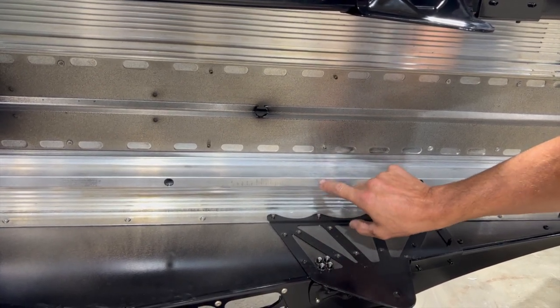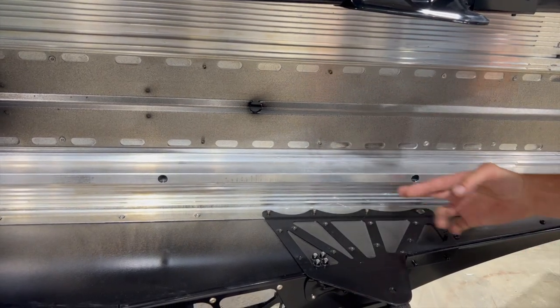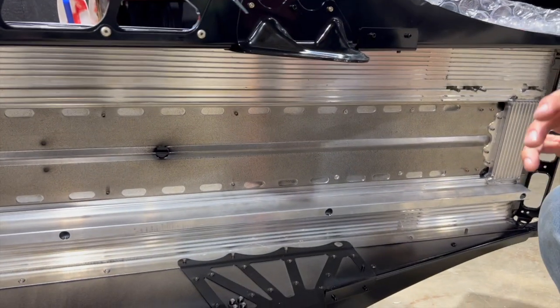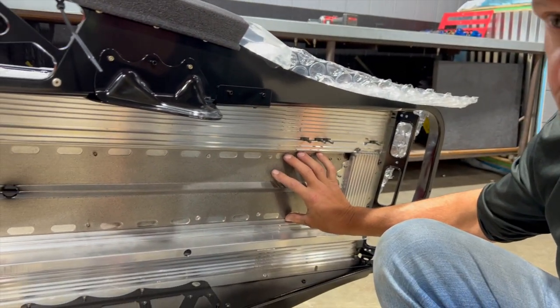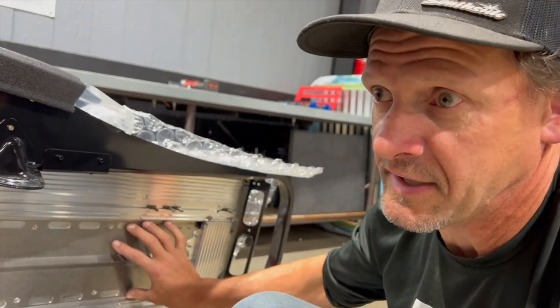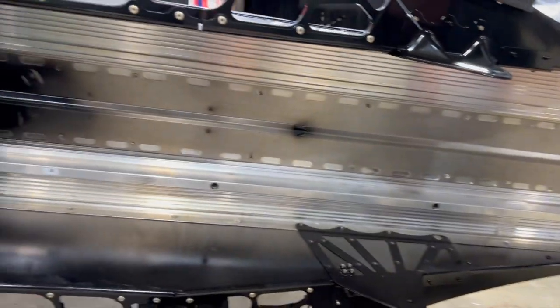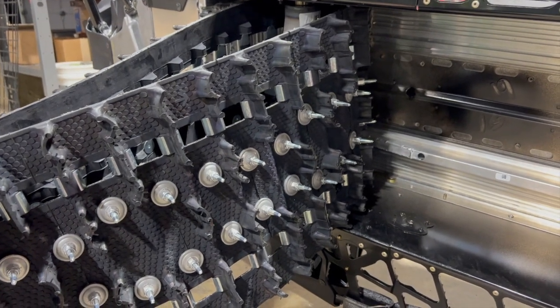this is what's helped keeping the track and the whip factor of the track and the studs rubbing against where the coolant is. So when I'm studding stuff for people, I'm always doing it in the center, unless somebody tells me that they want it on the outside belts because they want more traction.